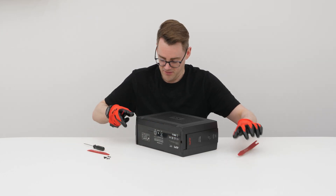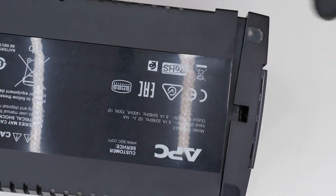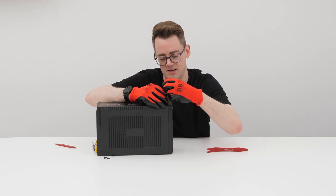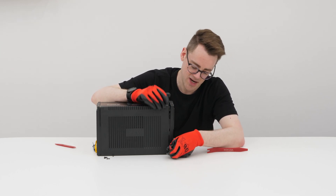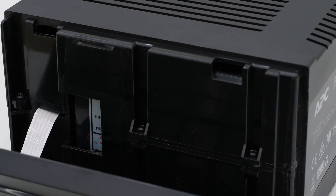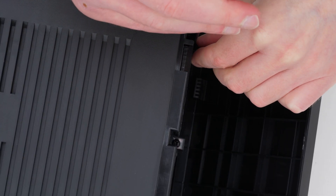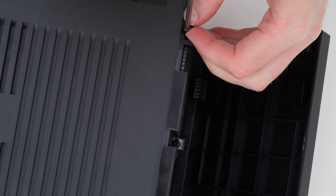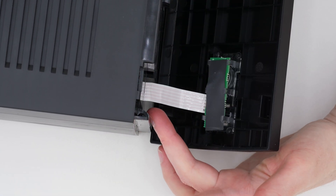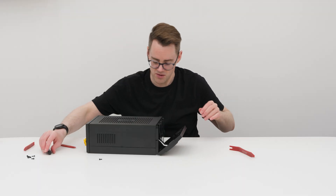And yes, this is a faff. Once you've got one off, it's always easier to get the others off. Just slide that down and it all pops on. Now, be careful with this because there's a ribbon attached. It's got our first screw here. Thankfully, these screws are all the same, so I'm not going to get them confused — though if you've got a slightly different model, that may not be the case. And then there's a final screw here at the top. Screws are removed.